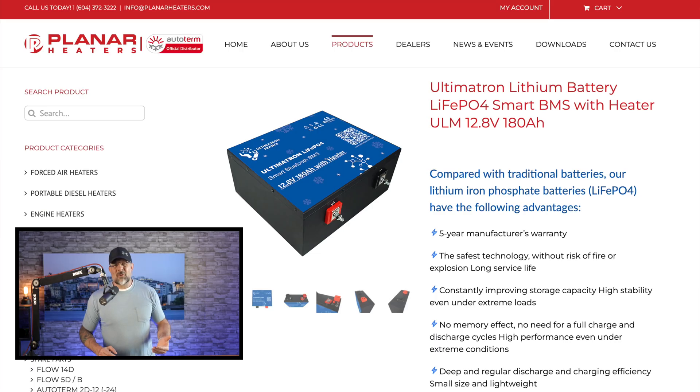Getting an appropriate amount of power requires evaluating your power needs but also factoring in the weight and space you want these batteries to take up. In a small setup like mine, 200 amp hours is likely a perfect fit. But if you have a big rig, you'll likely need bigger batteries and potentially more of them. A buddy of mine has a 2021 or 2022 Mercedes Sprinter van, and he has two of those Ultimatron 180s in there over on the driver's side.